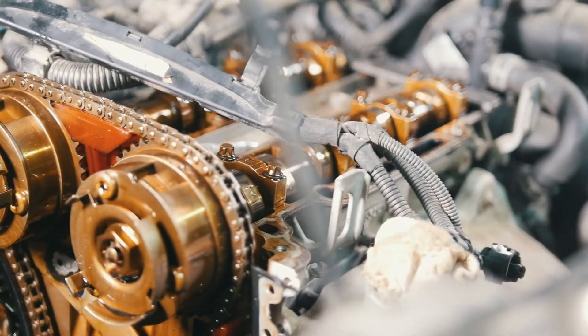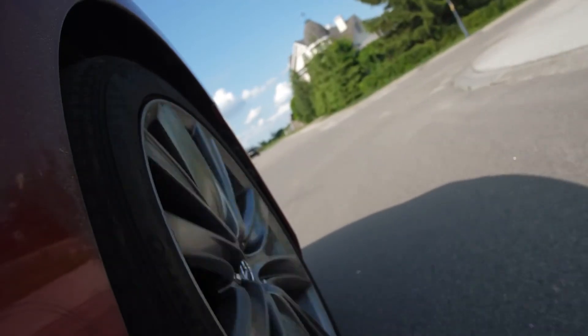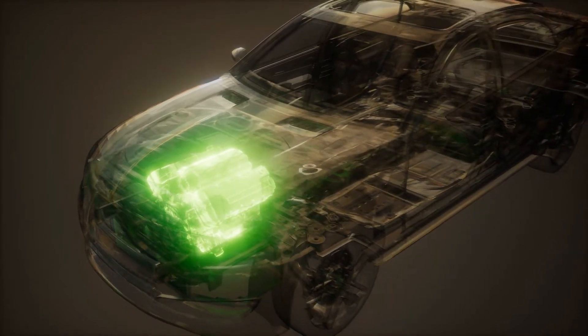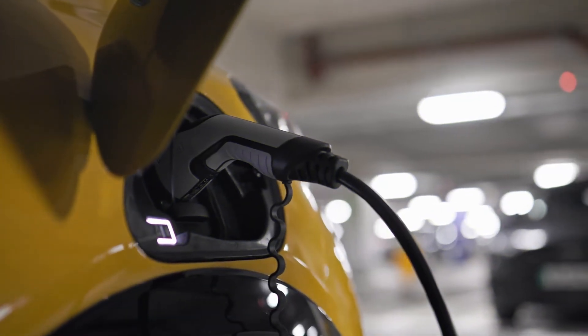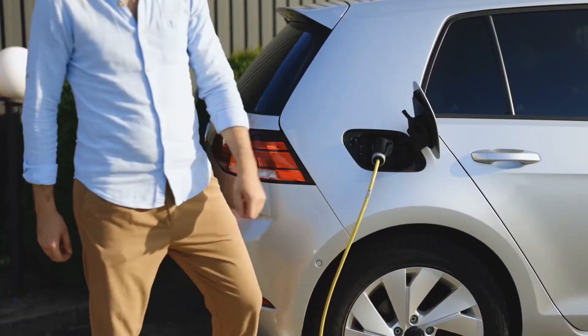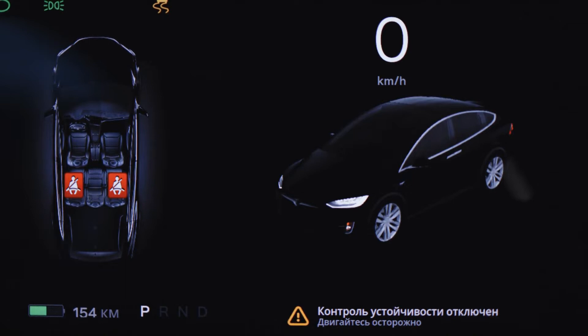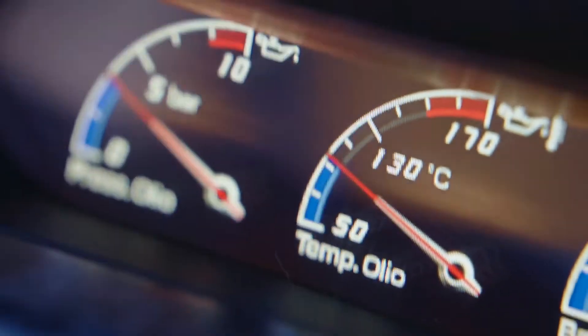How well does it work? All transfers of energy inevitably lose heat, noise, light, or other energy, so no machine can be perfectly efficient. Regenerative brakes usually lose 10-20% of the energy from braking, and the car loses another 10-20% when converting the energy back into acceleration. This means most hybrid or electric vehicles have 60-70% efficiency with their regenerative braking systems, which is pretty consistent across all types of electric vehicles. It's important to note that 65% efficiency does not mean regenerative braking will add a 65% increase to your car's range. Instead, it simply means that 65% of the kinetic energy loss during braking can be used for acceleration, placing less strain on your car's battery.